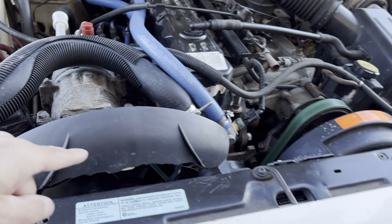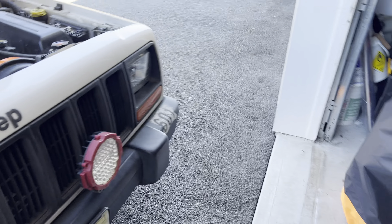I'm having problems with the shroud — I had to chop it up a lot. I love that Grand Cherokee clutch, it blows a massive amount of air on the motor, and that's what four-liters lack. The stock fan clutch just doesn't blow enough air on these motors. But it sits too close to my radiator and I kind of don't like it.